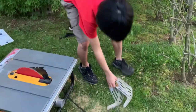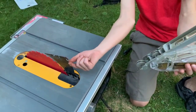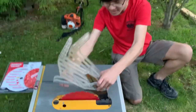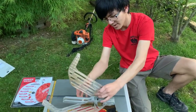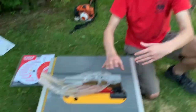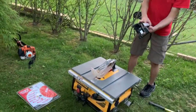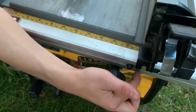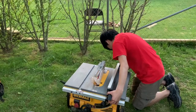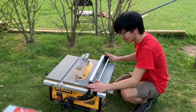We're going to put the guard back on — the spacer is pretty self-explanatory. For the guard, all you have to do is take a look at the hole right here; there's a little axle that you're finagling into this little notch — it should go like this. Then you want to lift this lever so it can go to its fully resting position and put it back down. As you can see, the guard is in a nice position. Finally, this one just goes on like this — there's a nub right here that you need to insert into this notch. Lift these up, make sure you align them properly, and as you can see it's on both nubs. Just lock it in place and secure them.